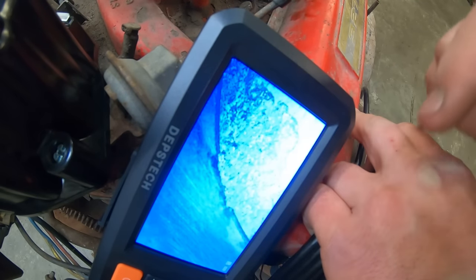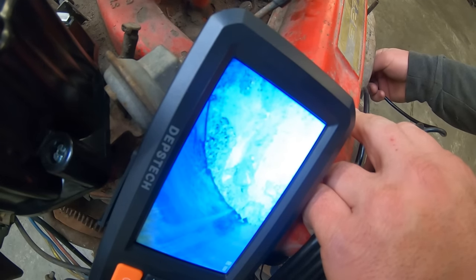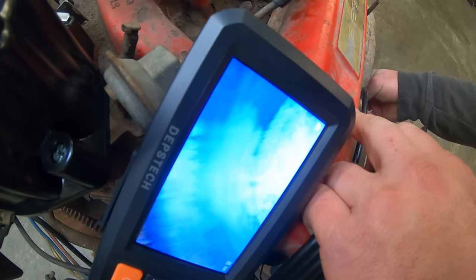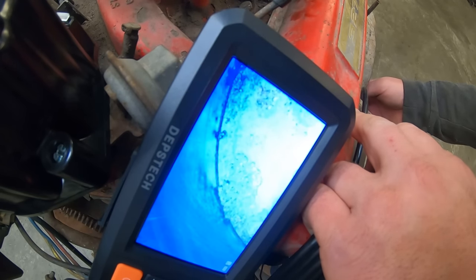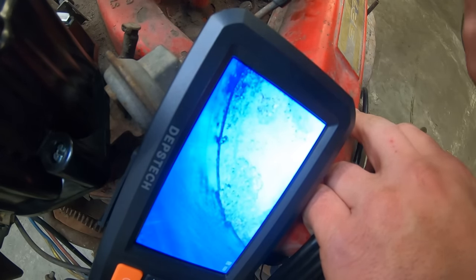Never mind that buildup there. You can see a little bit of the sludge that was on top of the piston down there in the lower left corner. But yeah, this is the one that doesn't have any compression. Number 4, one of the ones that doesn't have any compression. Hopefully the rings come out of it, otherwise it's worthy of putting a set of rings in, I guess. Or taking it apart, you could probably just clean them up, loosen them up, put it all back together.